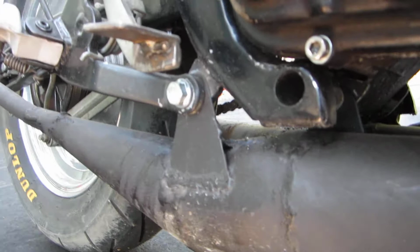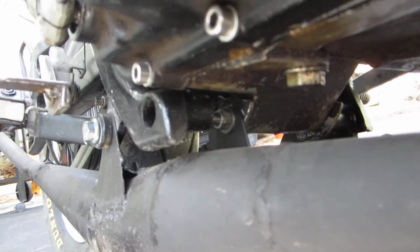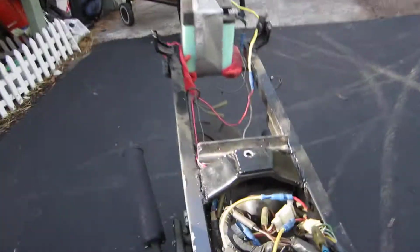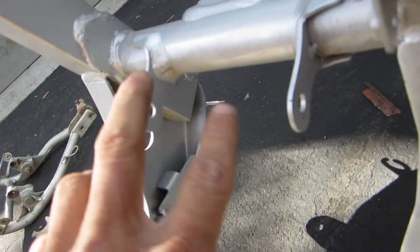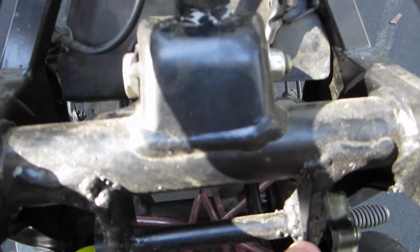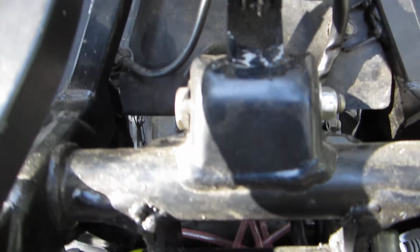There's a mount tang underneath the foot peg on the lower bolt. You have one little tang inside on the engine bolt, which goes through to the left side frame. And I added a piece of 1/2-inch tube through the original holes and slipped my 2 1/8-inch plates on each side and welded everything together to really strengthen it up. Pretty good compared to the original mounts. The original mounts are pretty flimsy.